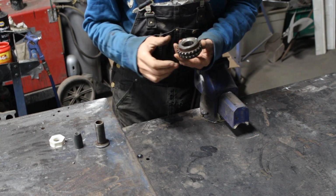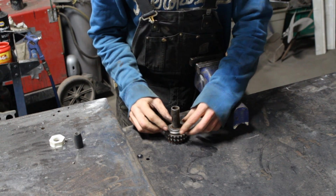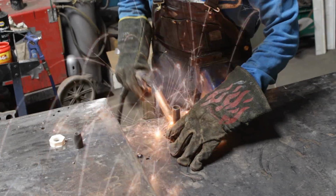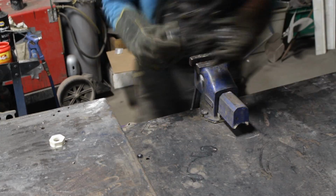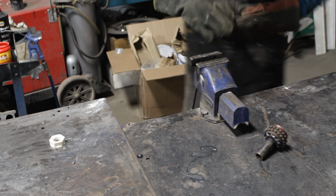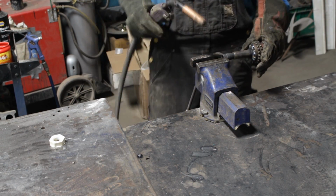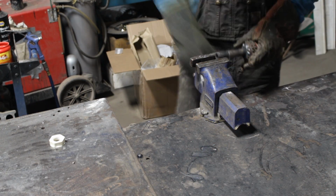so it was easy to attach it to the crankshaft. And I only welded this piece of tube there, so I can attach the degree wheel to it. At its end, I also welded this old half-inch socket, so I can use a ratchet to turn the engine.